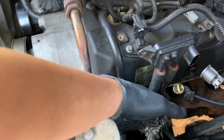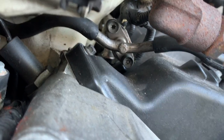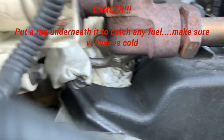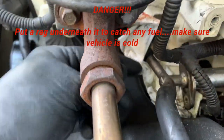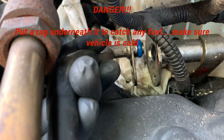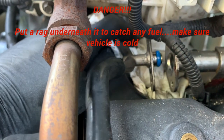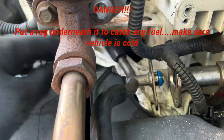Here's the fuel line — it comes from the front of the truck and takes a 27 hex, so that's what I'm using to unscrew it. I removed the two screws and put a rag there to catch any fuel. Let me show you from this side — we did get some fuel and you can see the rubber seal. If you have a bad rubber seal you may want to think about replacing it, but mine looks good. There will be some gas fumes so be careful.